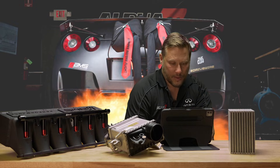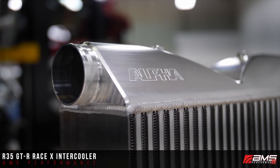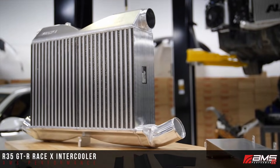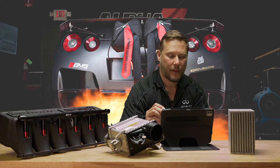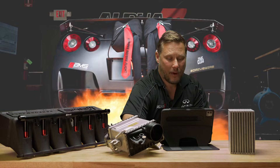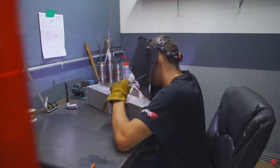The thing with air-to-air is we're typically limited by space — the frontal area of the car, how big we can get the core. How tall can you make the core? How wide can you make it, or thick? And that's why a lot of OEMs are moving to an air-to-water setup because there's a benefit to it — you can make it a lot smaller, and I'll go into that in a little bit more detail.